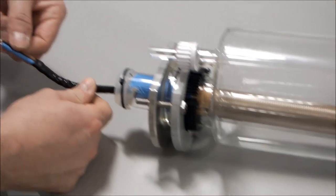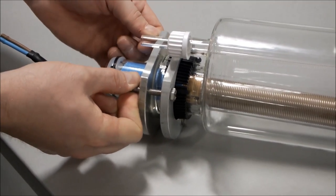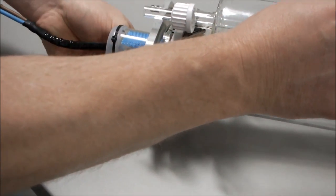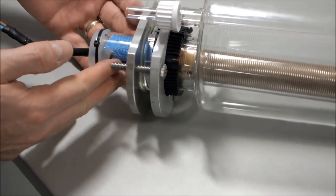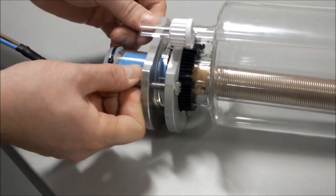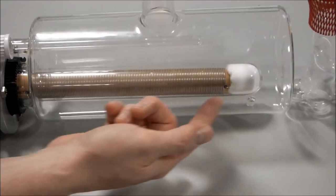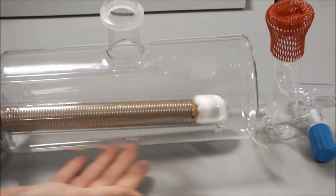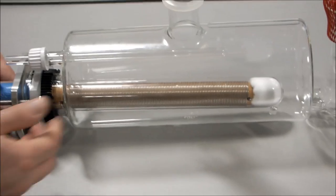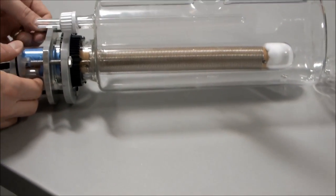When the heater cables are aligned, tighten the three screws evenly. Do not over-tighten the screws or you could crack the heater or the glass. The heater must be perfectly horizontal, not touching the end or the bottom of the boiler. When fully tightened, the bolts will pull the heater level.